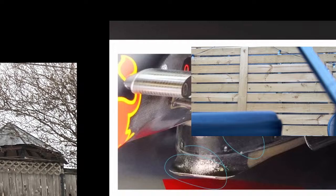Now, why are they doing this and what are the effects? At the front of this really fat keel, you'll have a high pressure stagnation region. Now, I don't think that's necessarily desirable. There'll be a bit of drag on there, and there'll be a little bit of positive pressure on the underside of the nose, which would generate lift. This high pressure region should help with generating local load on this particular portion of the T-tray. However, that particular portion is only quite small. And we'll obviously get some vortices spooled up and shed off there, but they won't be quite as powerful as some of the teams with full-size T-trays.